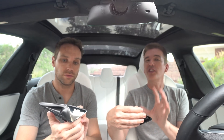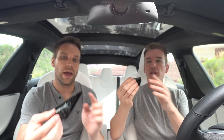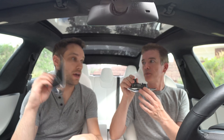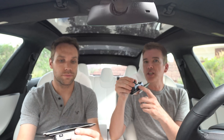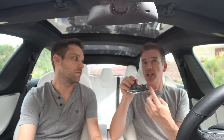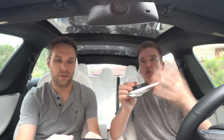One thing: if you look at the parts catalog, you can see there have been multiple revisions. The Model S and X look like they share the same cameras, but the Model 3 has different part numbers, and the Model Y has different ones because they're all blacked out instead of chrome. You can tell by the letter at the end of the part number. These are part number 1251006-00-E and 1251007, so they're slightly different because they're on different sides. The dash-E means this is probably the fifth revision. I'm guessing our old ones are probably dash-A. This is the latest camera currently being used in Model S and X being shipped. Cameras on eBay were older revisions — we wanted the latest one, not another 2017 camera.